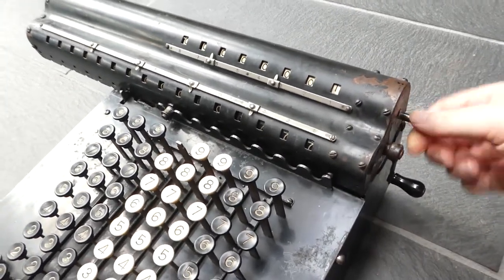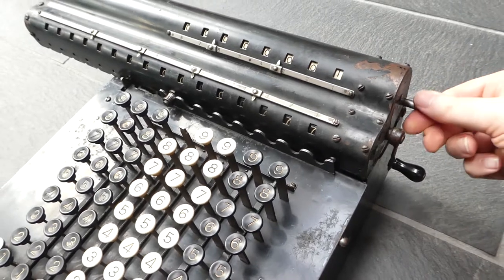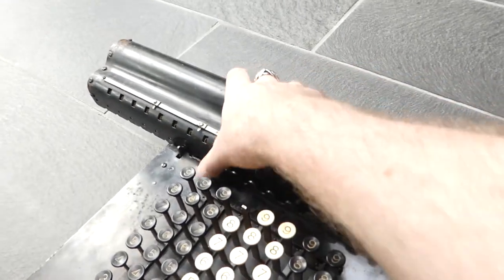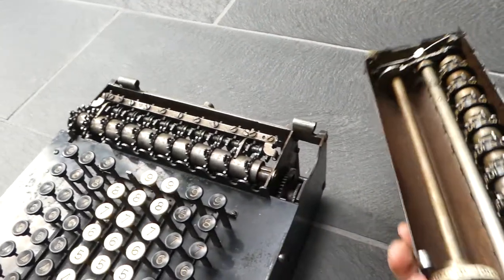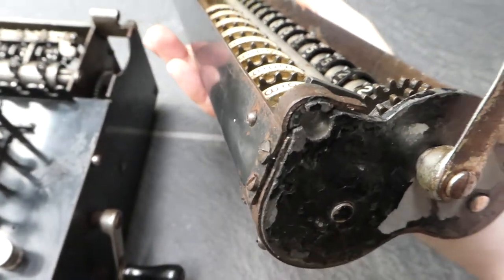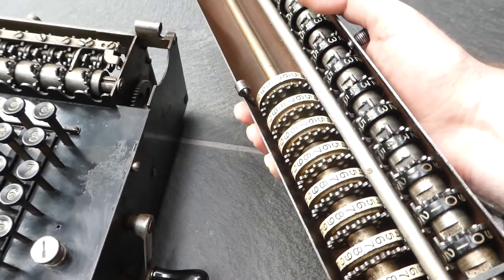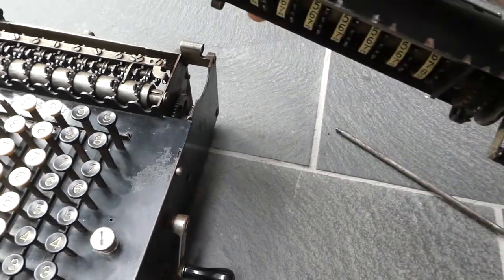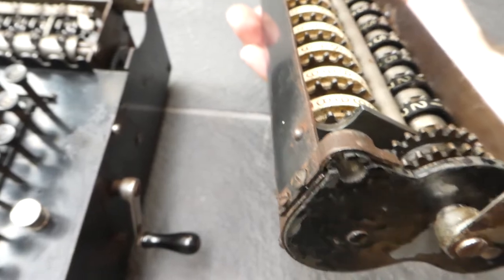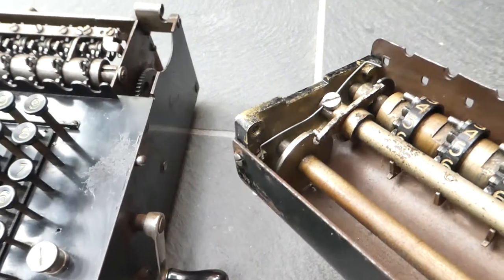So let me show you inside. I've unscrewed this rod for the carriage. This is a very heavy carriage. Note that this corner has been repaired. There are no springs on this rod to keep the carriage connected, so if you slide it too fast to one side or another it just bangs against the end — and that's apparently what has happened here. On these older machines the holes at each end of the carriage can be quite damaged.